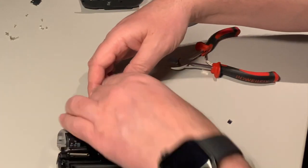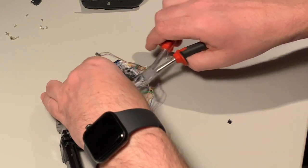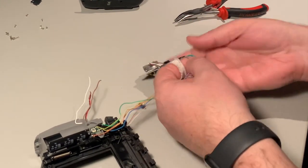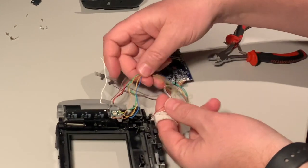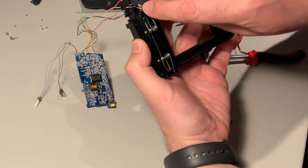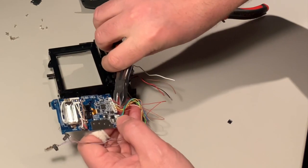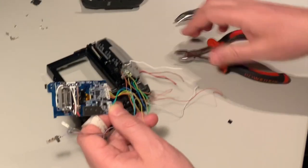Here is the painful part where I do not save the PCB — I just cut away one by one. I do it one by one because these two leads are for the capacitor and I really don't want to short circuit it. These two you can just cut. The red and the white here is for the LED — the little red one. It just lights up red whenever you run the motor, so I like to keep it.